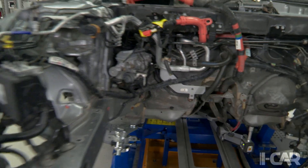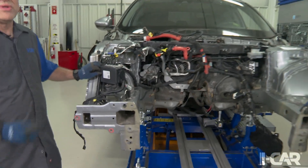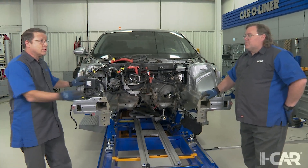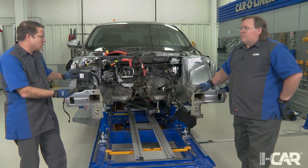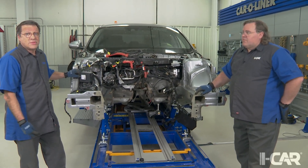And then we've got an analog brake controller on the front of the right rail. As I understand it, this system also ties in with the hybrid system on the vehicle, so that under certain conditions it'll actually command regenerative braking through the electric drivetrain if that high voltage battery needs some charge. And under conditions where it needs additional braking force applied, it'll actually apply the hydraulic master cylinder that we see there.